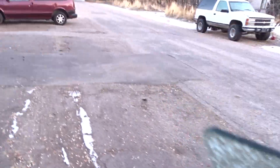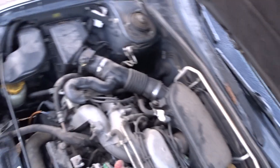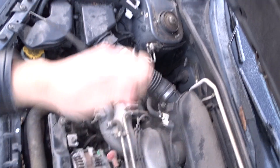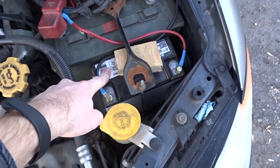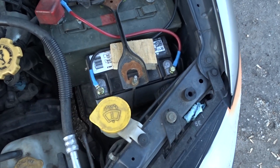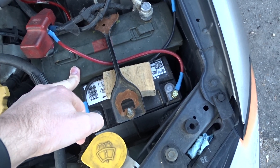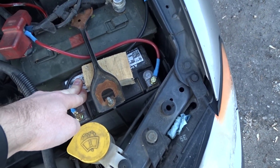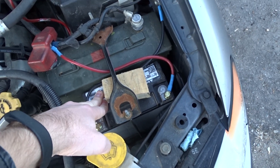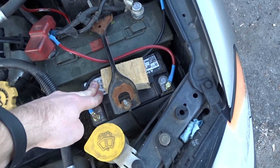Before I start it, I did add a small motorcycle battery — just for day-to-day livability — and you can see that wired in parallel here. Just a little size 20 motorcycle battery. The box itself remains unchanged from last time I filmed it. This just added to the cranking power a little bit, so it cranks a little faster, and adds a little more reserve so you can roll down your windows or listen to the stereo with the engine still off.